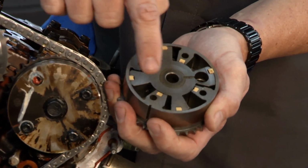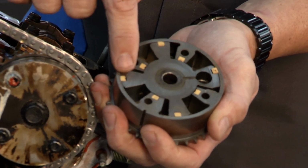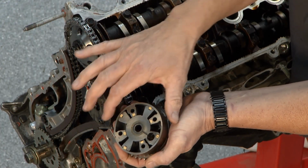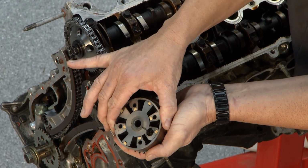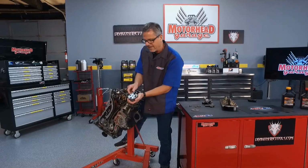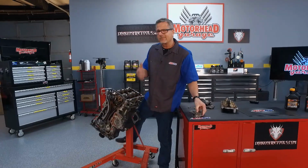Now what happened, these little wipers with oil pressure are gonna move. The camshaft, well, it's connected here and the timing's connected there. So when it moves, watch this. Bam. With oil pressure, mind you, you're going to go ahead and vary that timing. That's one technology. There's plenty more.